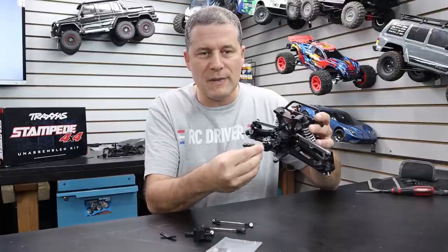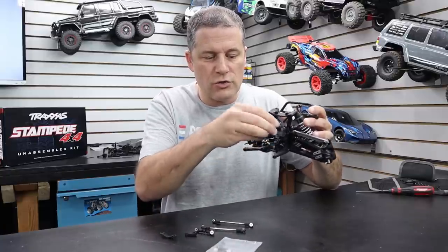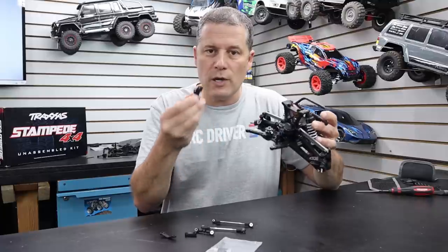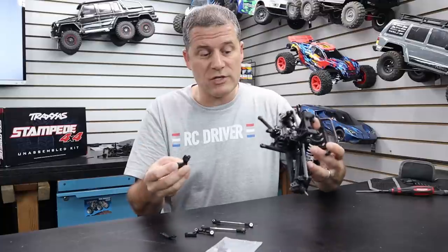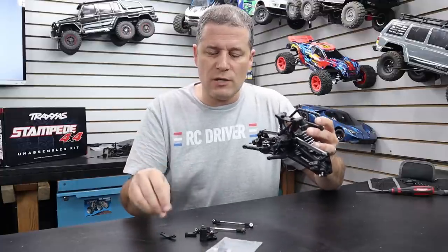Make sure that everything spins nice and free, and there's usually two cranks, and sometimes there's bushings inside that you wanna make sure have maybe a light coating of grease, or if they're ball bearings, you wanna make sure that they're spinning freely. So there's all these little things that you wanna look at.